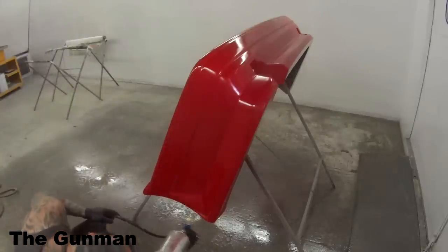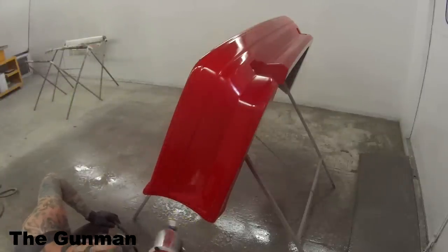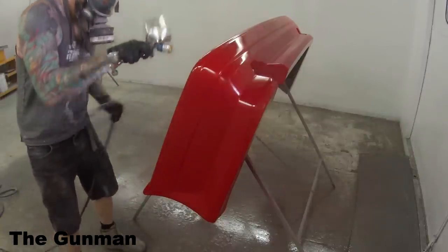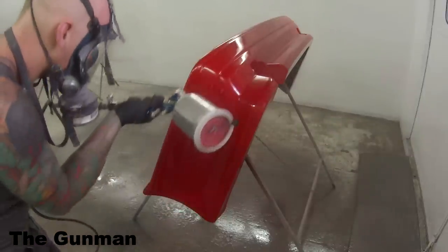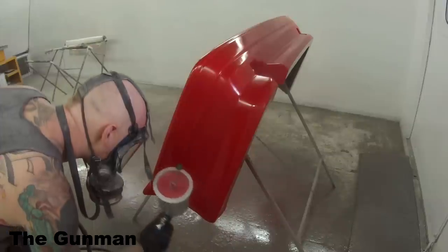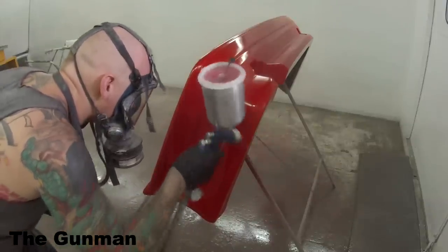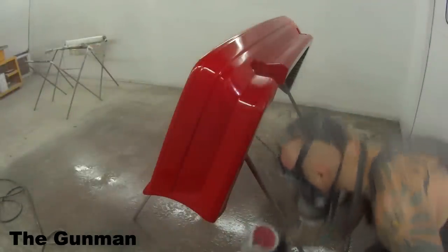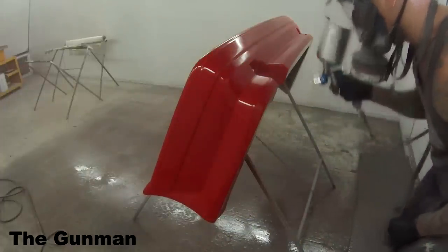By adding thinners I lost a bit of coverage, so I ended up putting three coats of colour over the top of this bumper bar — which wasn't a big deal. It was nice and warm, only taking about two or three minutes between coats. I didn't put the first coat on too heavy. The second coat I put on a lot heavier — you can see me slowing down. Between the second and third coat I walked out, had a break for five to ten minutes, then came back in and put another nice wet one over the top.